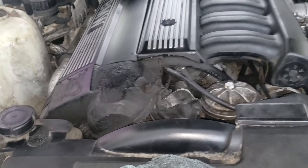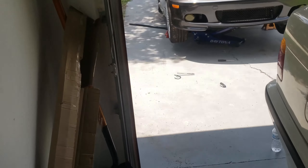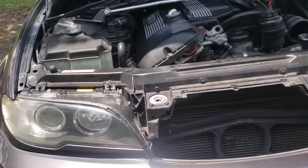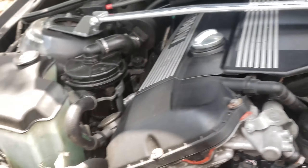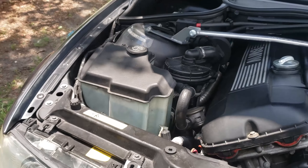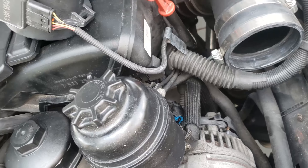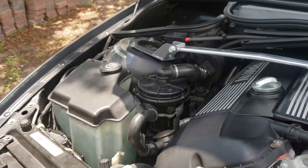As you can see, it's been sitting a while so it's really dirty. I've just been hitting it with some engine degreaser while I wait to hear back from someone. I actually had another failure on the ZHP where the alternator is going out, which is not too crazy — that's a pretty normal maintenance item, especially for a 20-year-old car. Literally just take the fan out, the air duct, and you've got it right there. Just unplug it — make sure to unplug the battery first — then unplug it and pull it out.